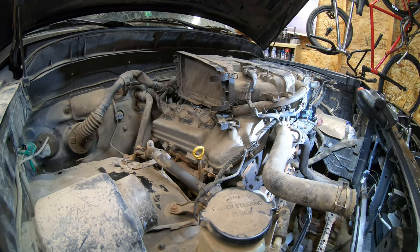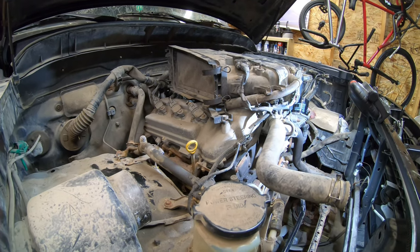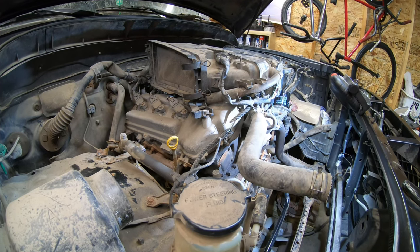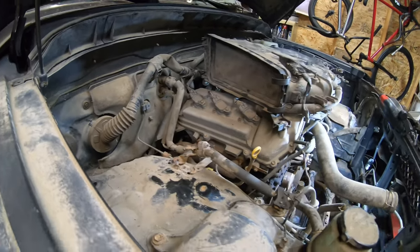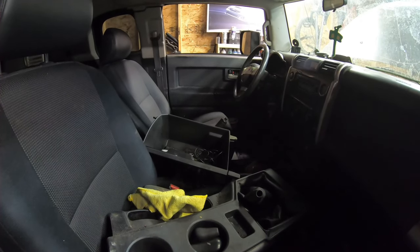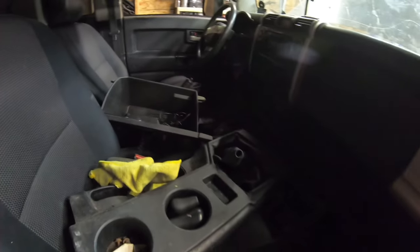What's wrong with this vehicle is that the engine was knocking and the transmission has no reverse. I got the vehicle as-is — a lot of parts have been taken apart. The clutch was removed, I had to remove the transmission. We're close to removing the engine; we just have to remove the wiring harness, fuel lines, and AC lines. There are also a lot of interior pieces removed and a bunch of parts in the back.